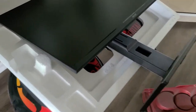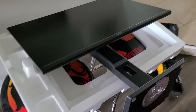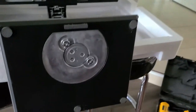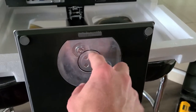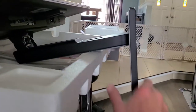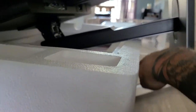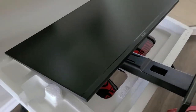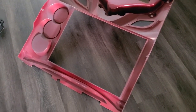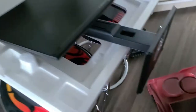Just a little tidbit here — after testing the monitor everything is going to work just fine. I've decided how I want to mount it. It sits in there like a shelf like I showed you. I took the base of this particular monitor off, took out these three screws, this cap comes off and I actually rotated the base and put it back on. Now the base sits back behind the monitor and I can secure this base into the cabinet by putting a piece of wood over this right here and bolting it all down. I'll show you the finished product — that'll hold everything super tight in place. I'm going to put some plexiglass over it with a little black bezel on top so it hides the gap and pushes nice and tight into the bezel opening.